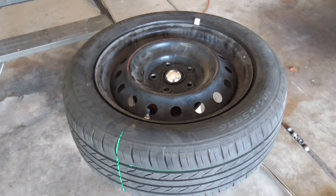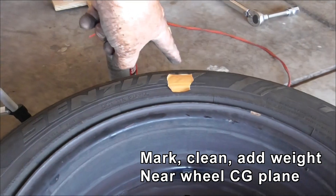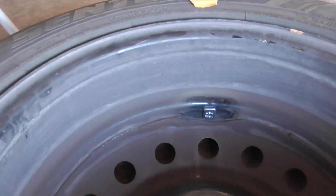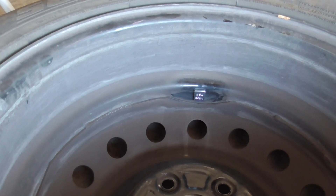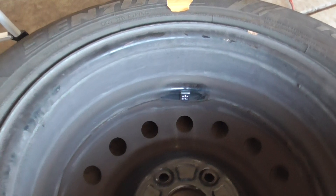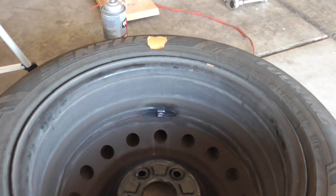So there it is rocking away, and that's where I'm going to add the weight. I mark the inside of the tire with a piece of tape to where I need to put the weight, cleaned off the rim, and put the stick-on weight right there. The reason I'm using stick-on weights here is because it lines up very close with the CG of the wheel. If you stick a weight on the edge, it's away from where the CG is, so you can get some dynamic vibration. This one should not cause any dynamic imbalance — so it's my favorite place to put a weight now.